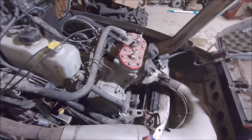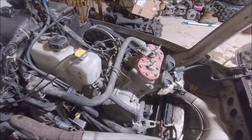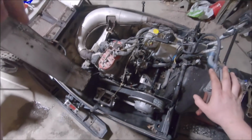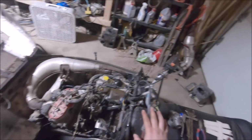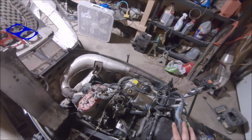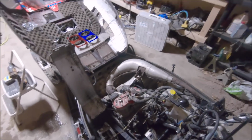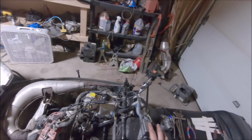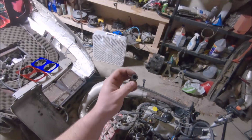I guess next, pull the carburetors, which I should have done, but I haven't done it yet. All right, so I pulled both the carbs, went through them. They got 350 mains, should be good to about 0 degrees Fahrenheit. So in other words, it's pretty much gonna run rich anytime I ride this thing, because I don't like riding when it's cold anyways.